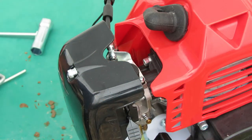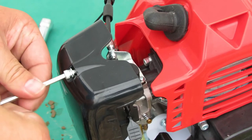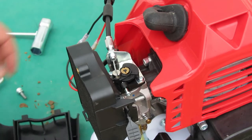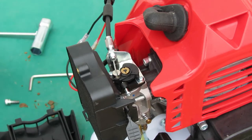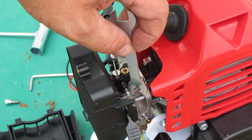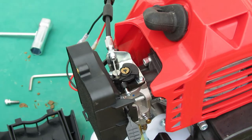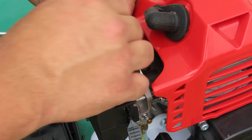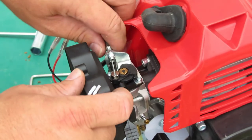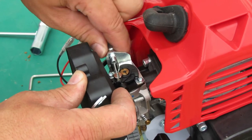I'm going to use the tool kit again and pop this cover screw out. You might be able to squeeze in there without removing the cover, but this'll be easier and better to see. There's a gap between the idle set screw — the low air set screw — and the throttle linkage, so that needs to be adjusted. I'm going to loosen the lock nut, run the screw in a little bit. Yes, that looks like it's really going to help. Back the nut off and run it in — that's all the way up against idle right there. Perfect.